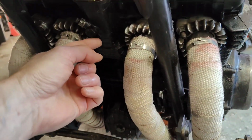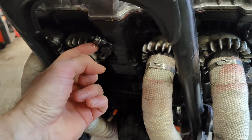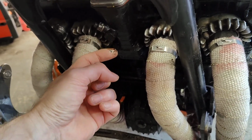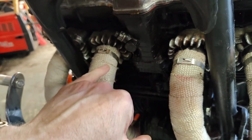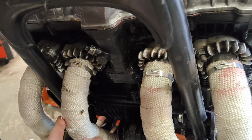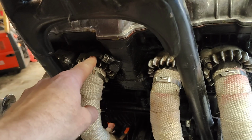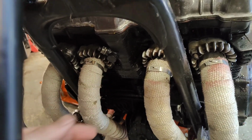So when I had it running, it seemed to be leaking oil, and I'm wondering if it's leaking the oil here. Is it coming out of this? Maybe I need to reseal that. That would explain where the oil's coming from. Yeah. Okay, I think I found that then. So yeah, the oil puddle here has come from this bolt, which I assume is some sort of pickup or feed, or I need to find out what that is. Well, that's handy to find that.